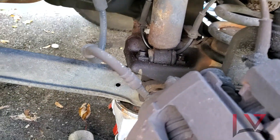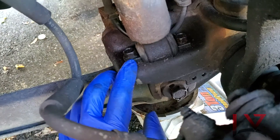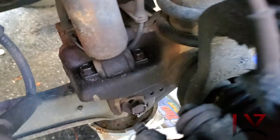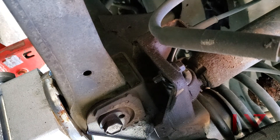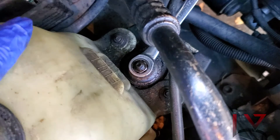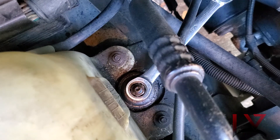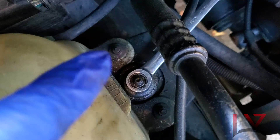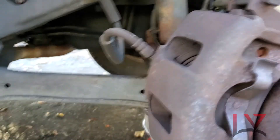So we're going to replace it today. First of all, there are two bolts here that are 13 millimeter. There are also a lock nut at the bottom which are also 13 millimeter. And at the top there's a bolt close to the reservoir — this one right here — it's a 15 millimeter. The first thing we're going to do is loosen this bolt at the top, then we will loosen these at the bottom.